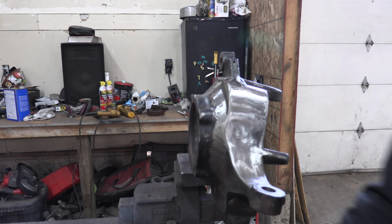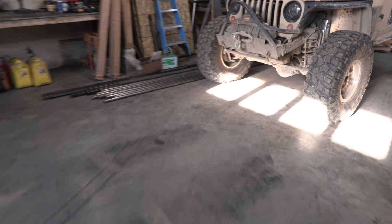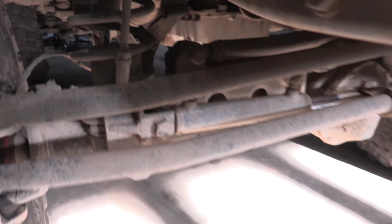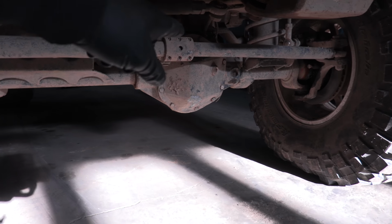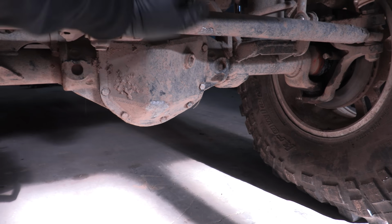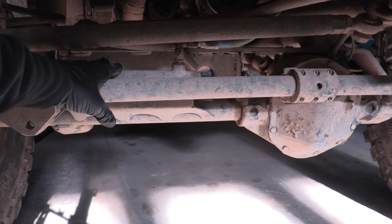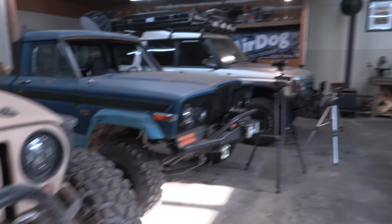The reason I want to do that is because I don't know exactly how much distance I'm going to have to clear this front cover. A lot of times you have to bend the tie rod to clear the front cover, as I did here. So I have a little bend in this guy, and a little bend over on the other side, to make sure I have enough distance whenever I fully turn one way or the other. I want to make sure I have enough clearance back here that these don't contact at any point. I also want to give myself some room in the future because, like you can see here, this has hydro assist steering, and I'm probably going to end up having to do the same thing in the Land Rover, so I want to have enough room for all that.